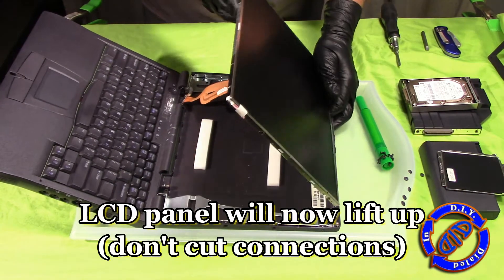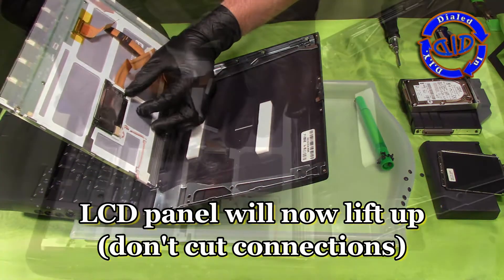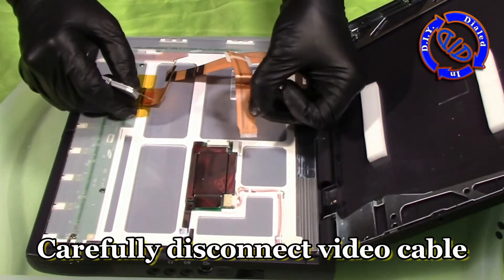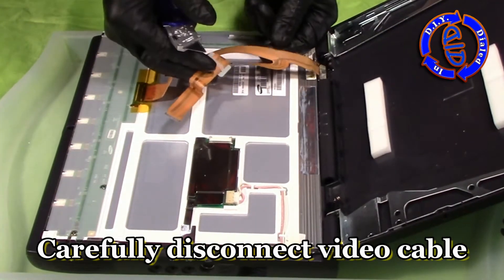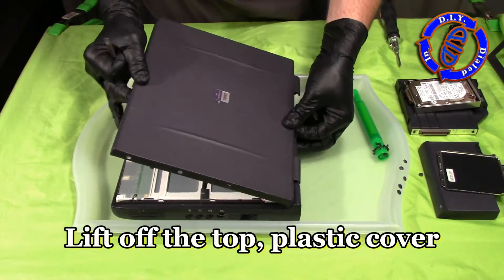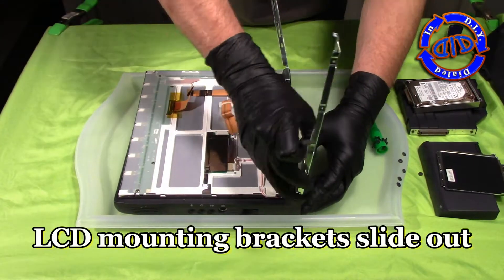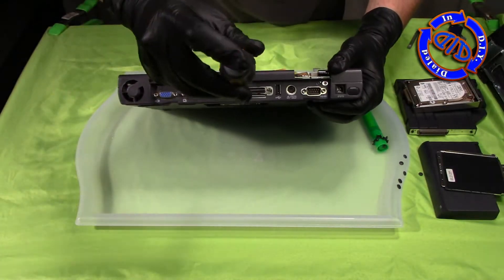At this point the screen will actually separate quite nicely, but there are a couple of important cables attached that you want to be careful to get out without cutting them. First you want to unlock or untab the little latch that holds them securely into place, then remove the video cable as well as the inverter cable. I still haven't removed the screen yet because I have some more plastic to remove in order to get to the end of the inverter cable and safely remove it as well.